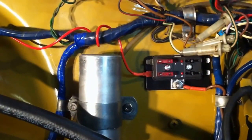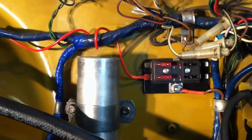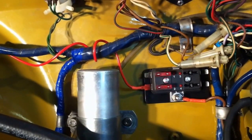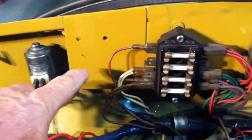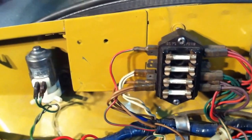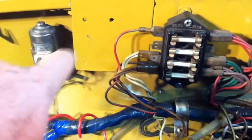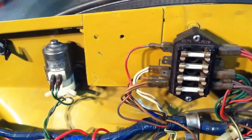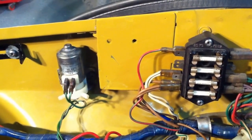And then once I put the relay on the auxiliary plate there, I'm going to have the ignition and the rear lights that are going to be controlled by it. So I took this metal plate here. I chopped that up and made a plate that fits there, and I did some spot welds on the top, and I put a couple nuts on the back and welded them on so that I can just screw onto them without having to fiddle around with nuts holding on to the relays themselves.